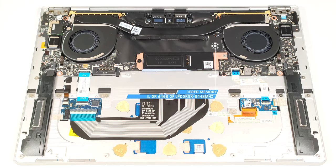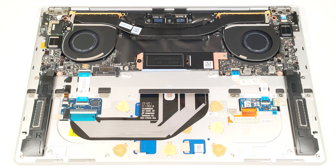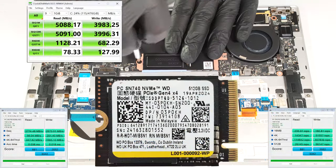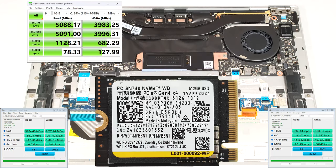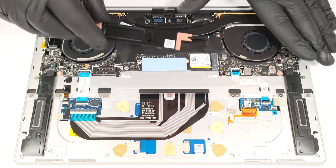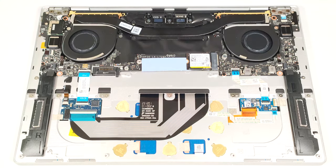You get up to 64GB of soldered LPDDR5X, 8,448 MHz RAM in dual-channel mode, which sounds like a future-proof amount. In terms of storage, there is just one M.2 slot compatible with 2230 or 2280 Gen 4 NVMe drives. The SSD here has a metal shield on top that is fixed to the chassis with one Phillips head screw. When you undo it, slide the cover to the left and lift it away from the chassis. The NVMe is additionally cooled by a thermal pad below the metal plate and one more pad underneath the SSD itself.